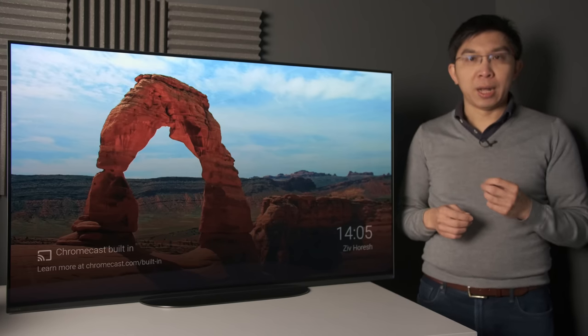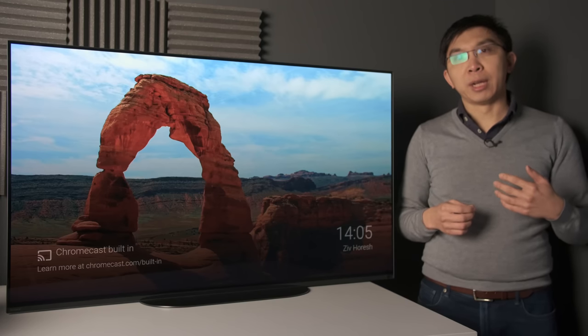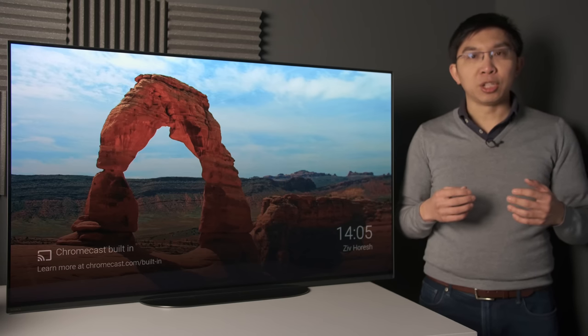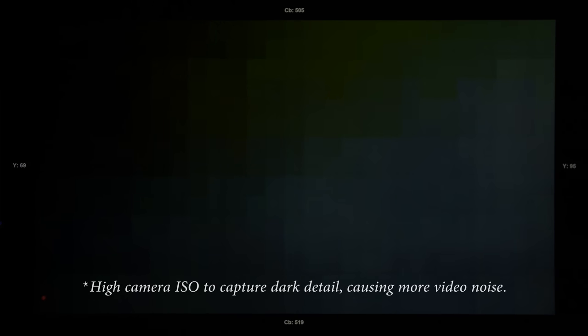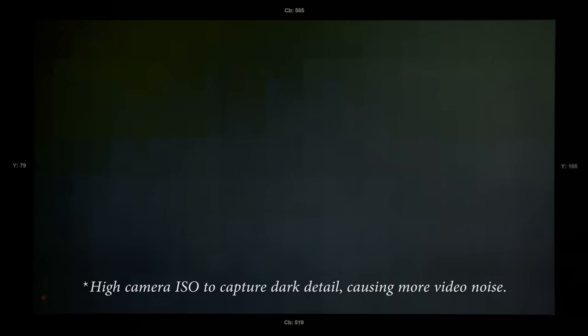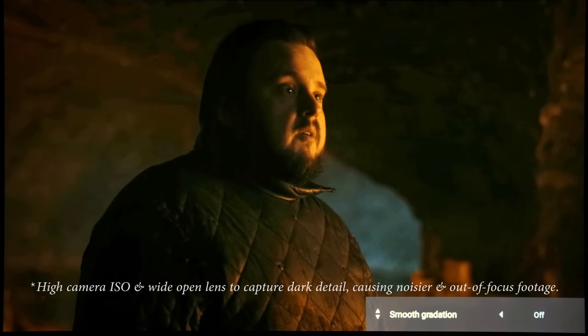The Sony A9 or A9S uses a 2020 WRGB OLED panel from LG Display. All OLED TVs are capable of true blacks due to the technology's self-emissive nature, so we normally focus our attention on near black handling in our reviews. The Sony A9 didn't seem to employ any additional measures to mitigate near black chrominance overshoot beyond the TV's native superior gradation and LG Display's 2020 T-Con, leading to visible flashing artifacts not only on test patterns, but also in certain heavily compressed real-world broadcast material.